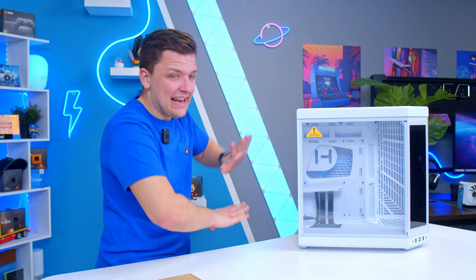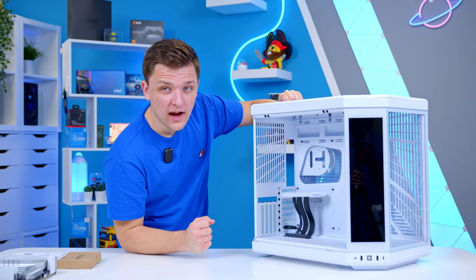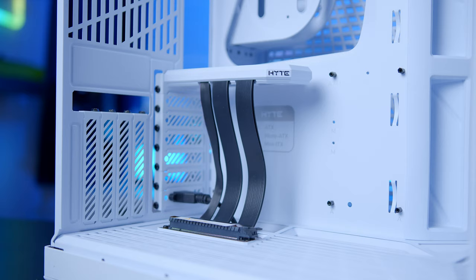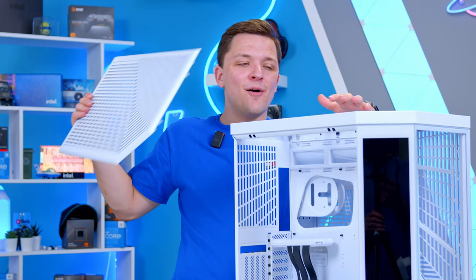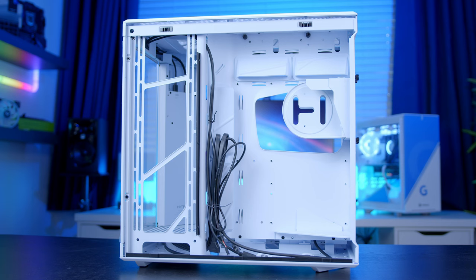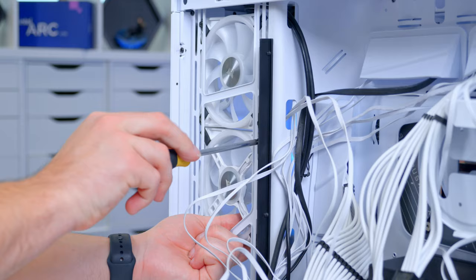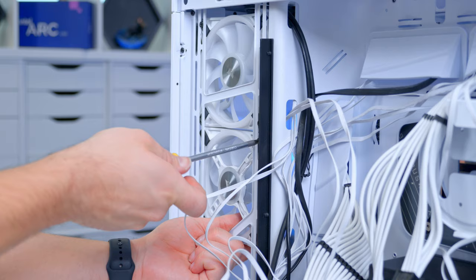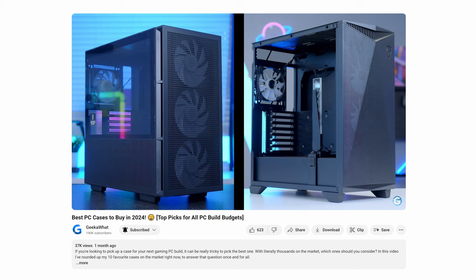Would you just look at that! We've got our tallest tempered glass panel that removes nice and easily. And then, of course, one of the signature pieces about all Hyte cases is the integrated vertical GPU mount — this is all pre-mounted and installed, with support for up to four PCIe slots worth of GPU. Support for full-size ATX motherboards with all of our cable grommets. The top panel is also removable, unveiling where our radiator can go at the top of the case. Like basically all cases being released right now, this is a dual-chamber case as well, which means all the gubbins of the PC — the power supply and any storage drives — are installed around the back. The only thing to note with this case is the lack of included fans, so you will need to go out and spend more money on fans. It's certainly not a cheap chassis to get going with. I think the idea is that people spending a lot of money on a case tend to throw away the fans anyway. If you want to trim some costs out of this build, there are other great cases to consider — I'll pop some cheaper alternatives down below.